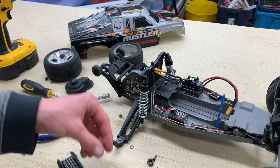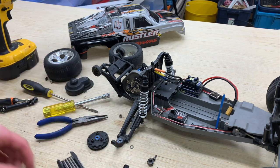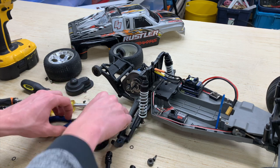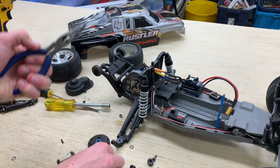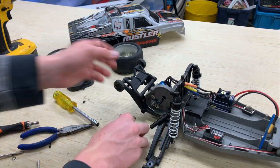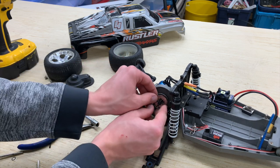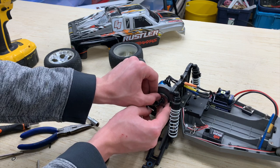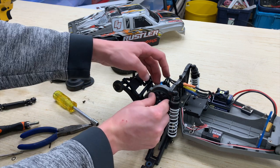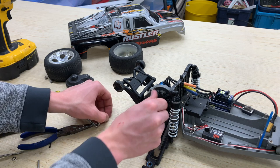There we have the old ones. Make sure to remove the teflon washer on the lower axle. Now let's get a new one — we're going to start off with the upper shaft and shimmy it backwards in. Observe which side has the threads. Now we can reinstall our slipper clutch assembly: the little retainer piece, then the pads — make sure to line up the grooves — then the actual gear itself, making sure it meshes back in with the pinion.